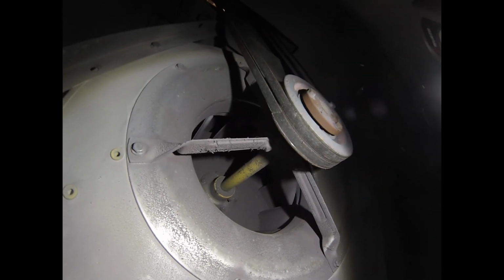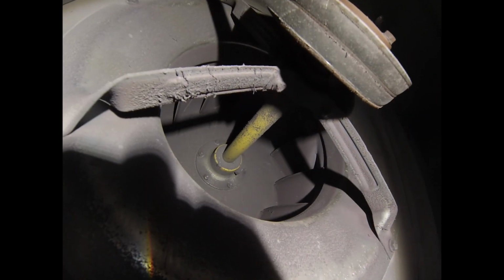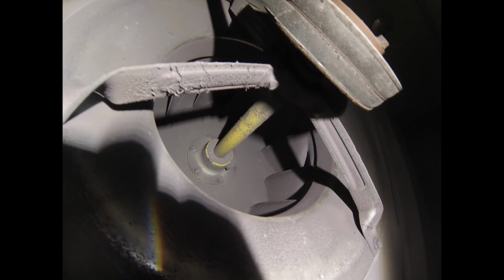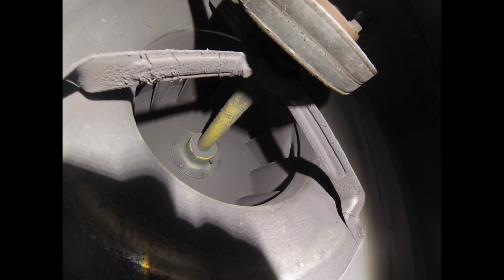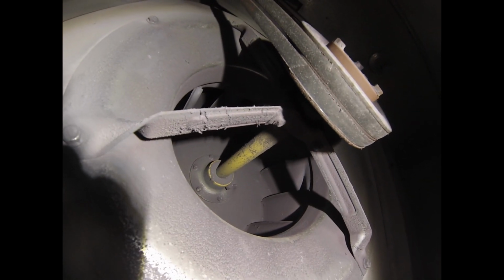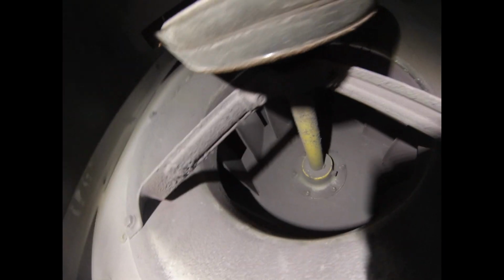So here we are inside the exhaust stack, inspecting it. You can see the squirrel cage on the motor has to be inspected from both sides. It sucks from both sides. It's really heavy duty compared to the other side because there is much more danger of damage. And this one has the tougher job drawing the exhaust out. So we'll inspect the belt, spin the bearings and all kinds of stuff like that, make sure it's okay. So you can see inside the exhaust stack there's a sprinkler right there, right? Okay, that's about it.